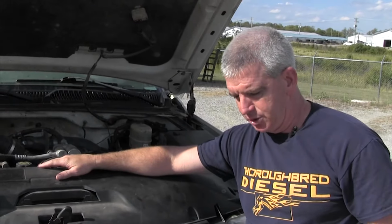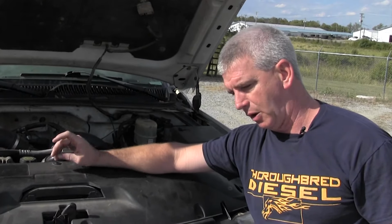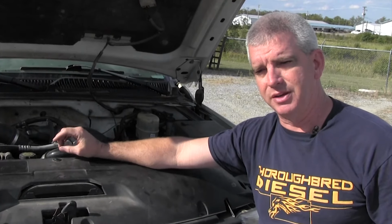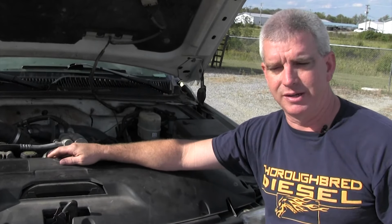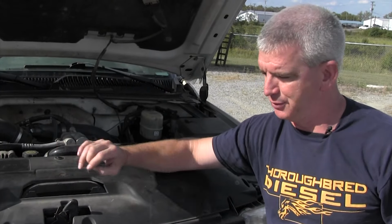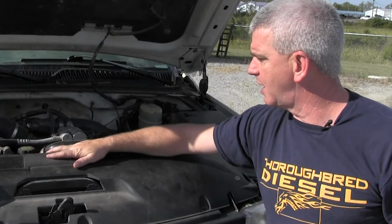The problem with the 502 code Bosch injector bodies was twofold. Quite a few of the bodies would crack, and it would fill the crankcase full of diesel fuel, and the nozzles weren't the best, so the nozzles would wear out, and that's where you got the hazy smoky idle. And the youngest of this series was 15 years ago, so those things have been addressed. There's a lot of really good products out there right now, so you don't have to worry about injector failures on these trucks, but it was definitely an issue in stock form.